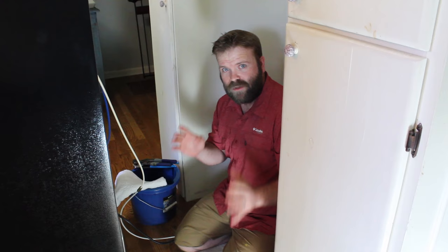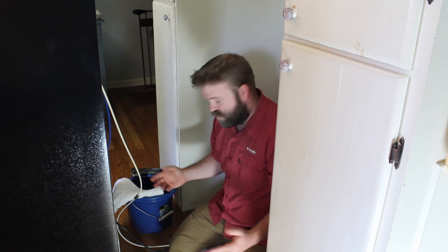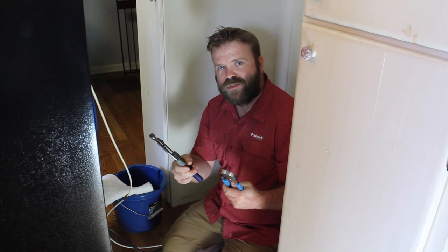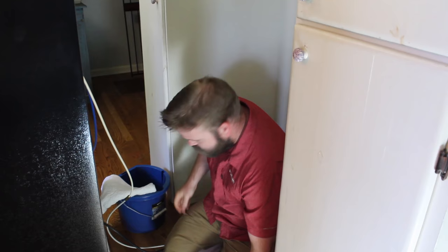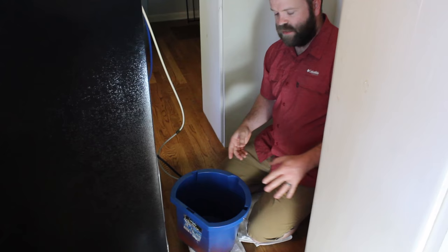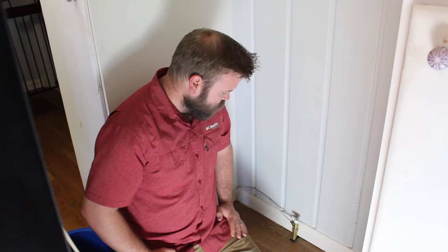Now I'm back here behind the fridge. You're going to need two sets of pliers — these are grip pliers, but you can use small pliers that twist in and out. You need something that will hold pipes. Also grab a couple of towels, one for your knees and one for water, because you're going to get a little wet. You'll also need a bucket — not for stopping water, but for bleeding the filters, which I'll show you in a moment.